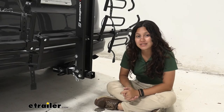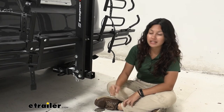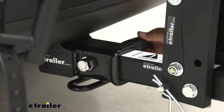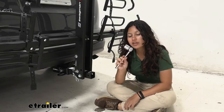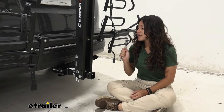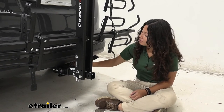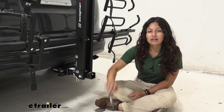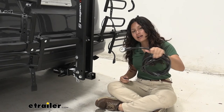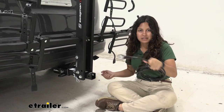This has a two-inch shank which fits into a two-inch hitch receiver, and it comes with an anti-rattle bolt. I personally recommend picking up a socket wrench with a one-inch socket or a 24-millimeter wrench, whichever is easier, because that makes it much easier to tighten down the anti-rattle bolt. At the end of that bolt is a lock — you get two keys to use with that lock, as well as a cable lock that you integrate onto the anti-rattle bolt and lock in place.